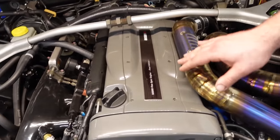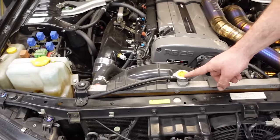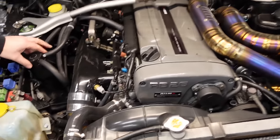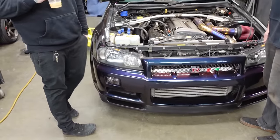Alright Josh, what are we going to do here? I kind of have suspicions it's a head gasket failure. So I'm going to pull the valve covers, do a leak-down on all six cylinders, and pop the crankcase to see if we can get pressure coming out. Just give us an engine health analysis, especially since it's warm now — it'll be more accurate. Thankfully, someone removed your front splitter and your under-tray for you. Your car's missing about 15 grand worth of carbon.